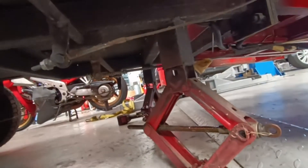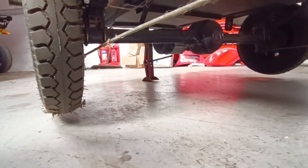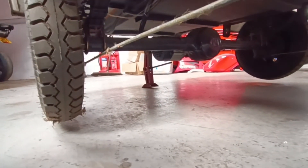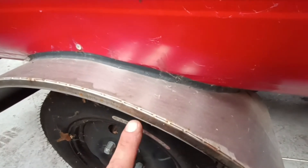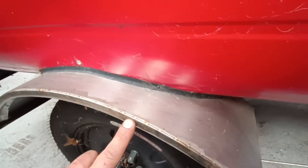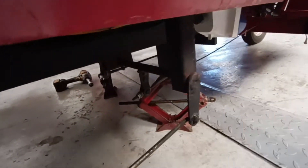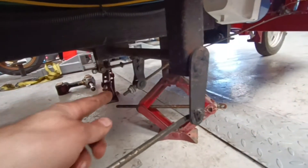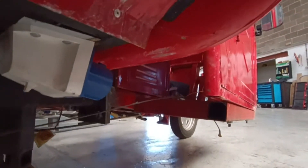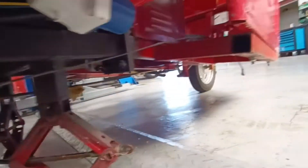These are the jacks that have been welded on. They seem to have put some half decent welds on that. But if you look at the back one — do you see the air gap underneath it? By the looks of that, they didn't weld that straight. Look at this wheel arch — 'Boss, do you want me to put a weld on all the way around?' 'No.' 'No welding, why? Cost money?' 'No no, just every two inches please.' Okay, so this handbrake cable I need to undo it, pull it out, re-lace it through the handbrake mechanism and do it back up, and I'll adjust the foot brake from there as well. Then we'll move forward to the front brake.